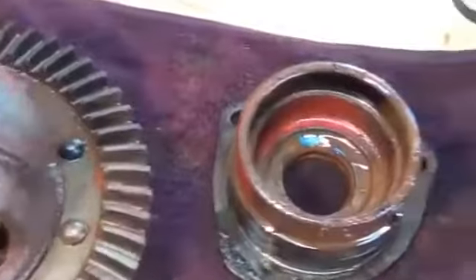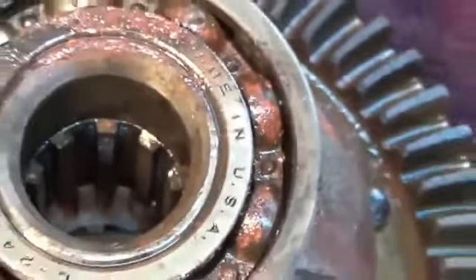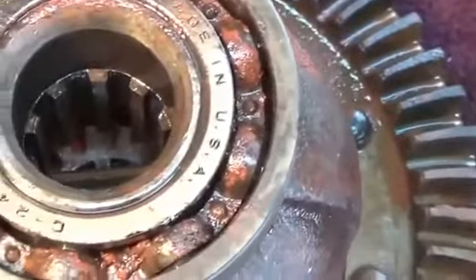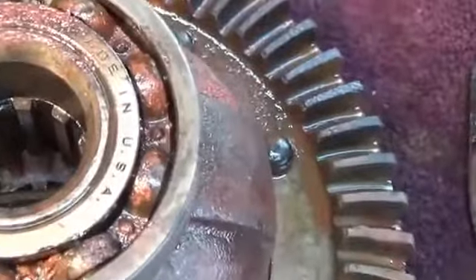Okay, we got them out. This is what they look like — bearing retainers. Bearings on the differentials — look at that, all the rust. They don't feel loose and they don't seem rough, but obviously all that rust has ruined them. The differential itself looks okay; I didn't see any missing teeth. The case on the inside was like a differential rusted chocolate pudding.